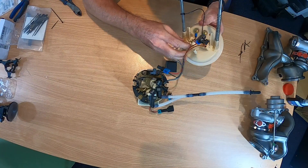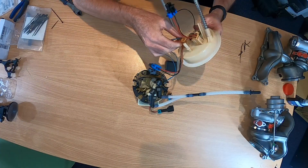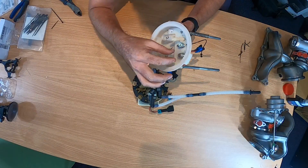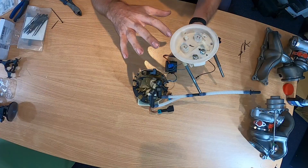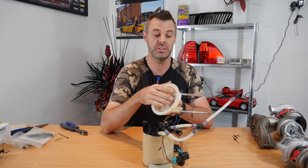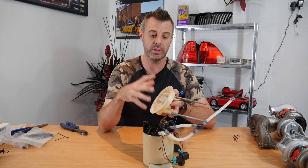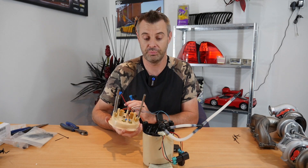If you're going to do this yourself using the original bucket, you can save a few dollars making up fuel adapter fittings into the Y-piece, but I actually did that with my first pump and don't recommend it at all — just spend the money. This Y-piece from BMP is worth every cent; I think it was around 20 or 25 US, and each fitting is 20 or 25 US as well. When I'm not so broke I will buy a proper bracket and all of this will go into the proper aluminium bracket instead. The second pump does require its own power, and we do that by just drilling into the top hat with two bolts which come through and are clamped onto the power — I've marked positive and negative.